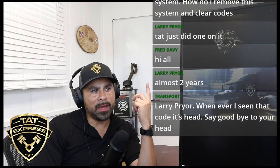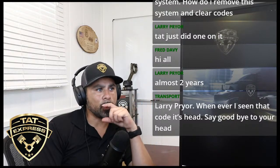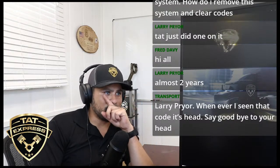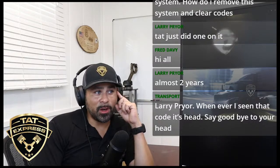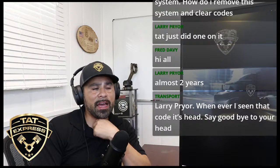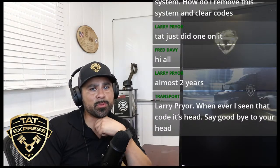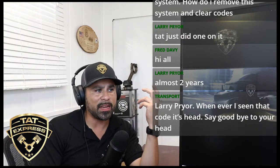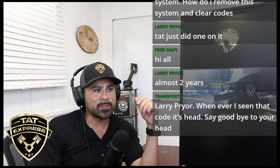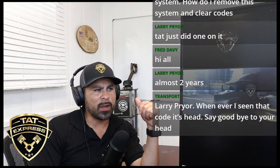Can flow be bad? If flow is bad, will it go down to the bottom of the coolant tank, or other reasons? Well, I don't think it's going to be restricted flow, man. If you're going to have restricted flow, it's going to get hot really fast. A lot of times with restricted flow, like if the pump is not pumping, you're going to have pressure really fast, and it's going to cause a lot of problems. So that's one thing that I mentioned right there.